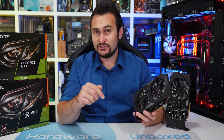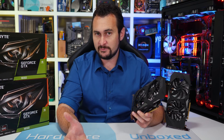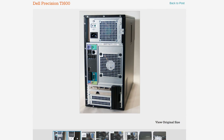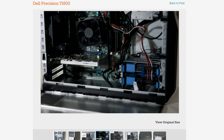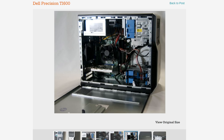If you guys can post some candidate systems below in the comments, that'd be really helpful — the more information the better — and I'll look into buying those PCs or seeing how viable this is as an upgrade. I've already discussed this with our Patreon community on Discord, and they seem to think the whole PCIe power cable-less thing is a bit of a crock these days. One member dug up the Dell Precision T1600 workstation with a Core i7-2600 processor, and the power supply doesn't have a 6-pin PCIe connector, nor any spare 4-pin MOLEX cables to use with an adapter.